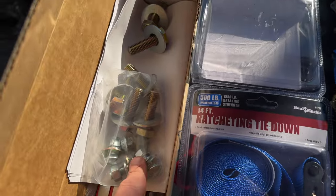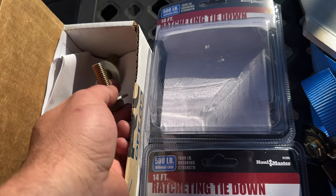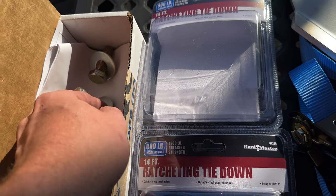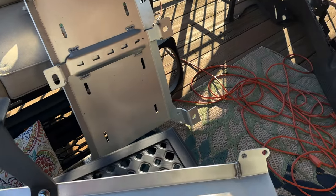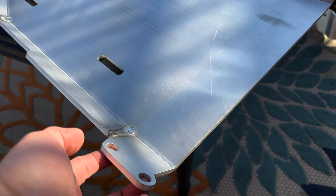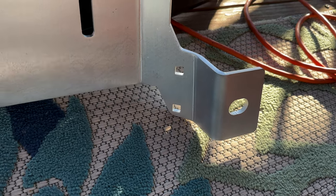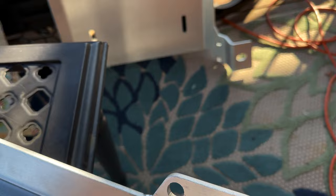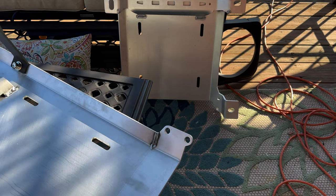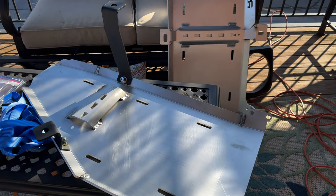But anyway, this comes with these bolt pairs that you just saw me put on. It also comes with these big bad boys here, which are used to mount to the Bronco's frame, directly to the Bronco. You put these bolts up top, into the Bronco itself, with those washers, and it comes with other ones here. Then the front piece overlaps this once it's sitting in. You see these holes back here and over here, and down at the bottom you'll see these square bolts. Those line up directly on the other side, and you put those bolts through and tighten them up. I won't do it before we get to the truck, but I want to explain that to you before we get under the truck. It's not always easy to film under the truck, so I figure I'll explain it to you now.